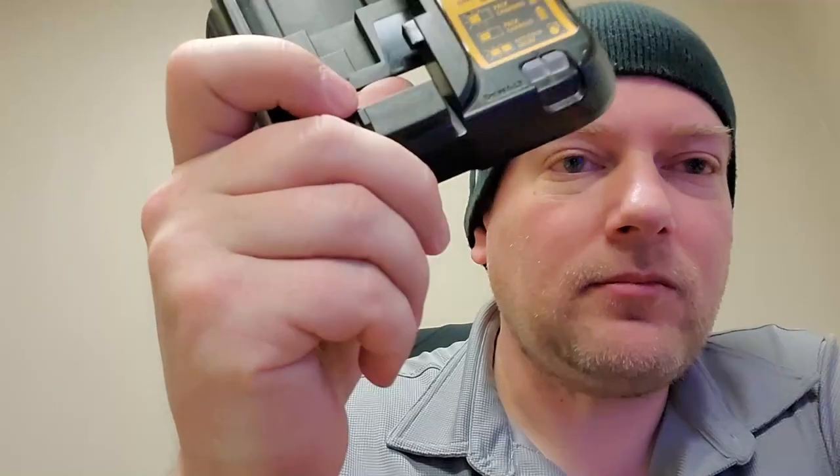I didn't really think they were going to be that different. There is a price difference — DeWalt chargers usually come for free with a kit, whereas Milwaukee chargers you typically buy separately. The fact that one is microcontroller-controlled and the other uses simple conditional ICs is significant. Both chargers are responsible for hot and cold delay, which is what the thermistor marking on the batteries is for — there's a thermistor inside each battery that measures temperature.